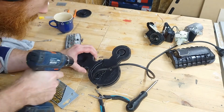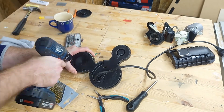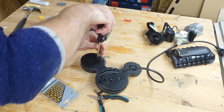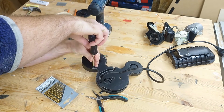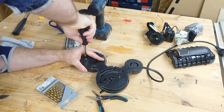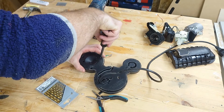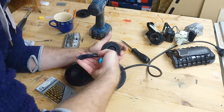And after a minor cleaning session, it was time to attack the base. And of course, Nespresso used the same shitty screws when putting together the bottom assembly. So this time I used a different tactic. I found a drill bit and I drilled out the locking pins of every screw. And then they came loose with a regular Torx bit like there was no tomorrow.